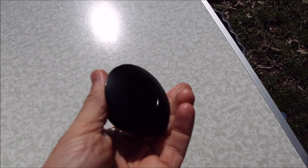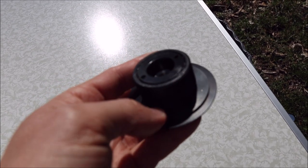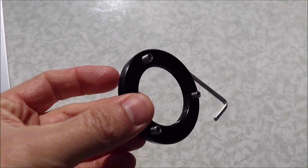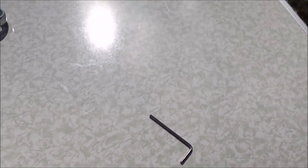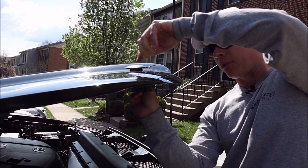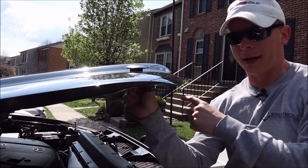This is the part that goes in the top of the hood, and the bottom does have a nice rubber or neoprene ring right there, so you're not going to have metal-to-metal contact on the hood surface. Before you thread this onto the bottom, go ahead and take three of those threaded rods and use the allen key to get them started, so it'll be easier to get those in without risking dropping them into your hood. The safest way to install that bottom ring to the top piece is to just hold it into place from the bottom, then twist the top piece until it's tight. That way all the movement is up here and you're not going to risk cutting your hands on that sharp metal underneath.